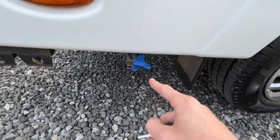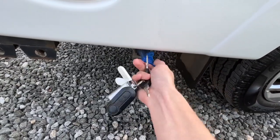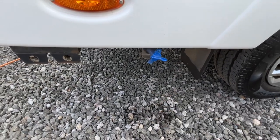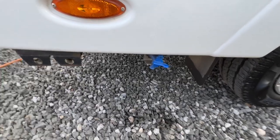If you want to get rid of the water, there's a blue tap underneath — open it and drain that off. Drain it off in the winter to avoid frost damage, or drain it off if you're not using the van or if you've taken on a source of contaminated water.